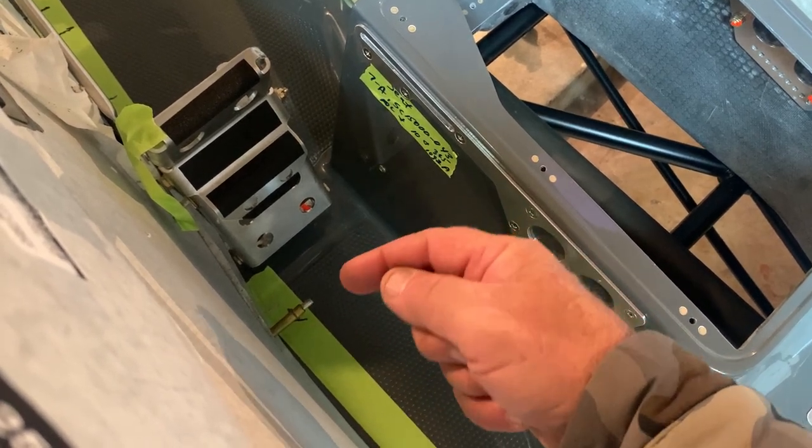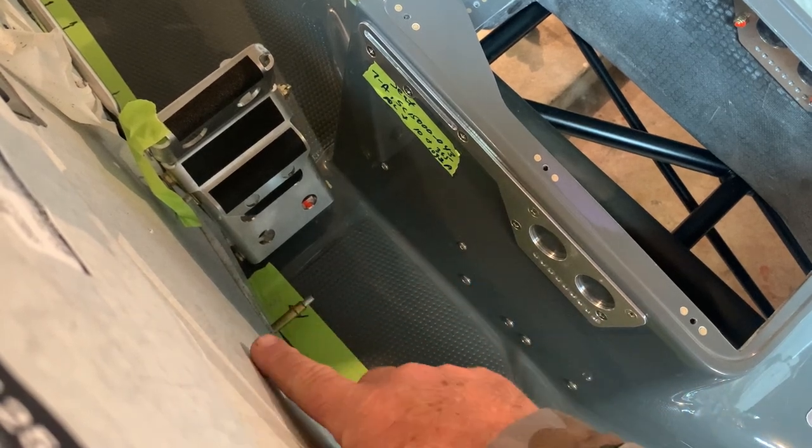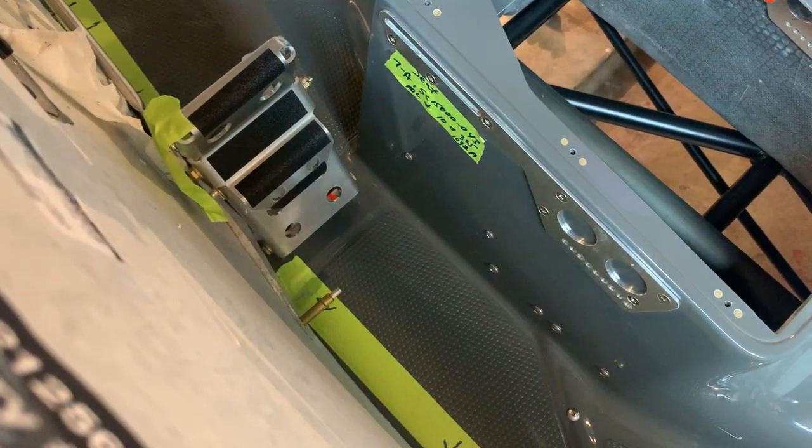So in any case, I just use a pop rivet instead of a squeeze rivet, and I can get behind it with some long pliers, hold the nut plate up, and then put a pop rivet through there. The rest of them, I'll just use cheap squeeze rivets on there. So in any case,